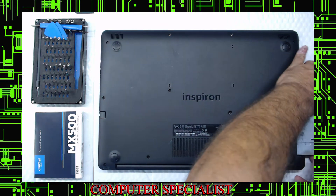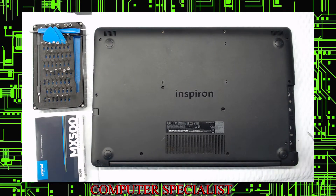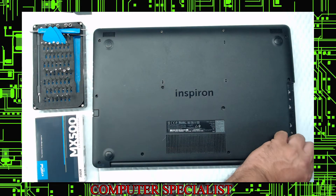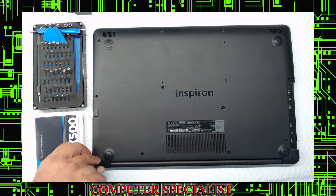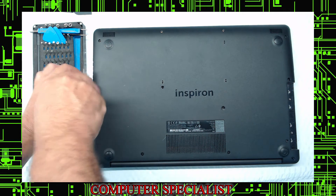On this model, right here you'll see two screws that need to come out too — those hold the bezel on. Some machines have three. You can always tell if one's been worked on when they're stripped out. Customers don't have a small enough screwdriver. These back screws, a lot of times, won't come out on some of the newer Dells — they stay in there while all the other ones come out. Don't go too crazy trying to pull them out; just let them sit if they're not coming all the way.